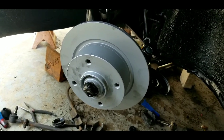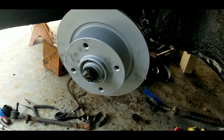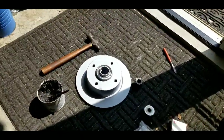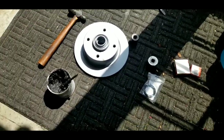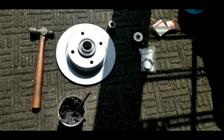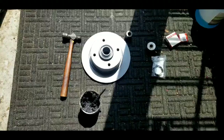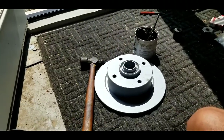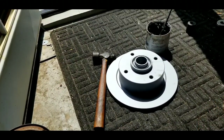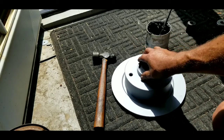On this side I jumped the gun even further and have got as far as getting the brake rotor on, which means setting the bearings. I'm set up right here to pound in my races for my front bearings. Let me see if we're going to be able to do this — maybe I'll try and set up the camera on a tripod. I'll set it up right here where we have some sunlight to give us a pretty good shot.